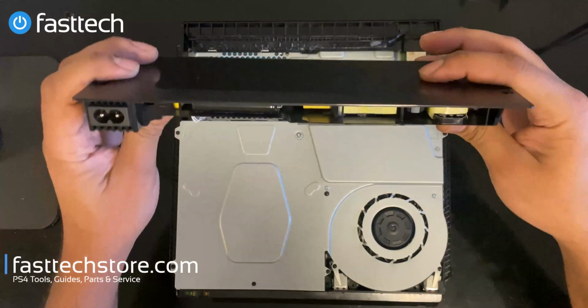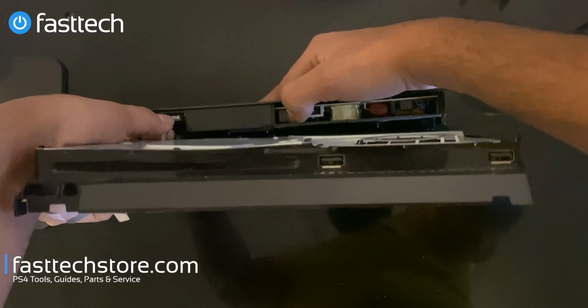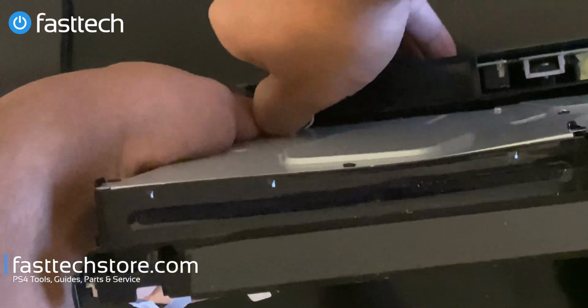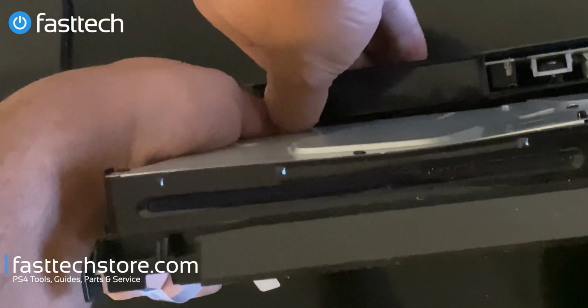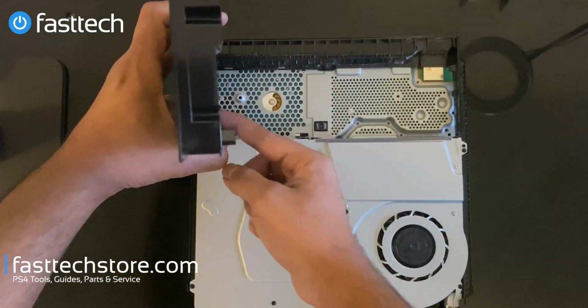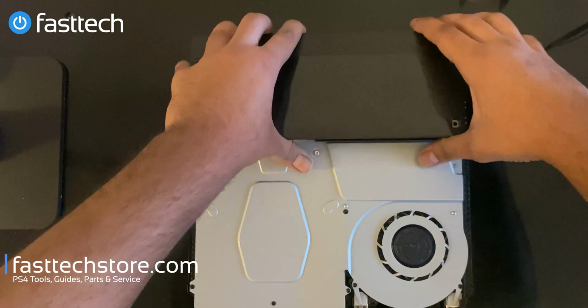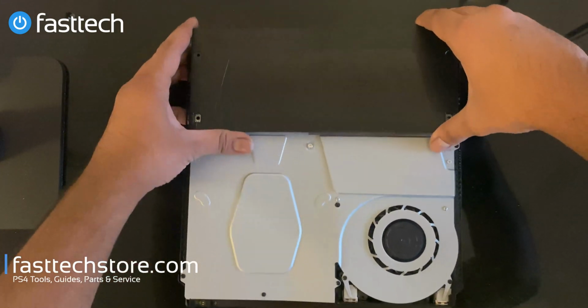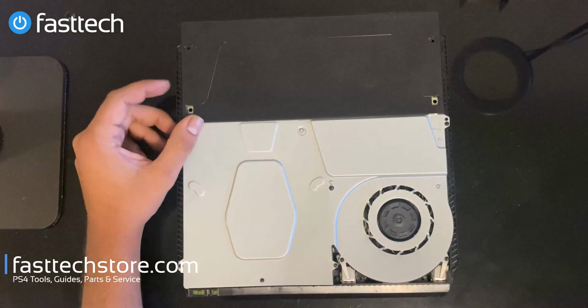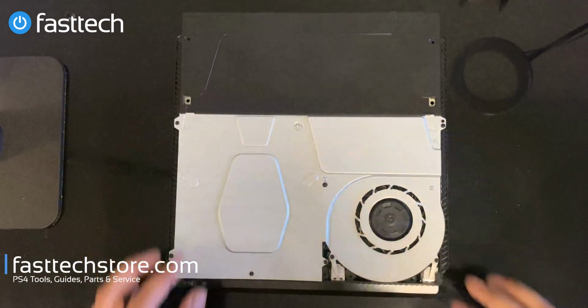So we're gonna put our new power supply in. You're gonna put this connector back in. Only goes in one way. You wanna make sure it's the right way in. All right, like that. These 2 pins right here, they must line up in here in the power supply. If you don't line them up properly, all kinds of weird things happen. So we're gonna put that in.